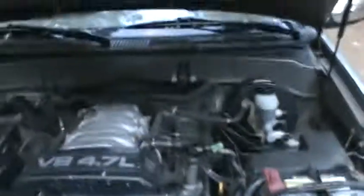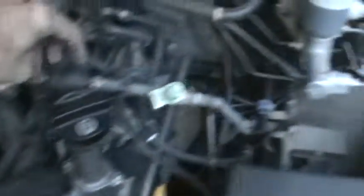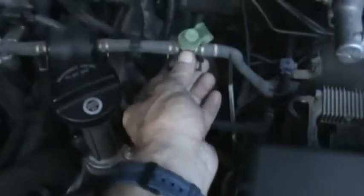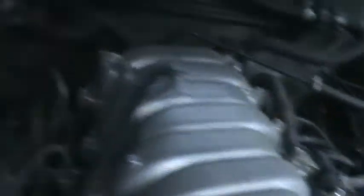Tyson, I hope this helps. Like I said, that was the hose that was loose on mine, but all of these hoses are part of the EVAP system. If you get one of those Haynes manuals, they show you the hose routing. But like I said, just find this little green thing and then start pulling all these different hoses to see which one, if any, has a loose clamp.